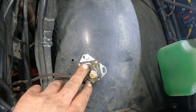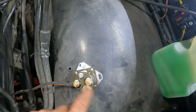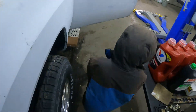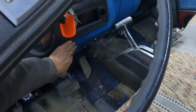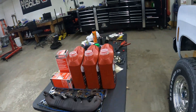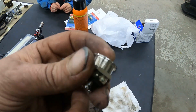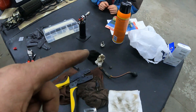These smaller posts here I'm going to use to activate the solenoid with a push button in the cab. We'll show you all that. I do have a push button for it. We're going to install that somewhere up in here, so when you're sitting in the cab you just push a button with your finger. That will activate the solenoid.